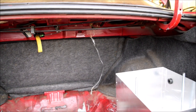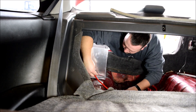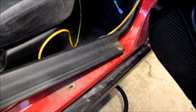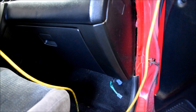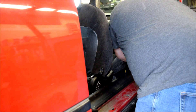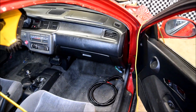Time to get the seats folded down and start running cable. I got the cable coming through under the rear seat, coming out right here. This is where we're going to go under the carpet. To remove this, all you do is pry it up - it's just clipped on. Then we'll be going through that channel all the way up here to the glove box. Cable's hidden nicely to the front where we're going to relocate the fuse box.